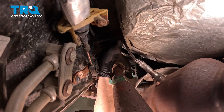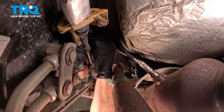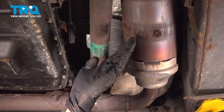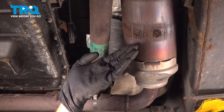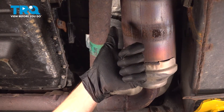We'll continue on with that wiring harness, bringing it up and over the mounting point, preventing it from falling down onto the hot exhaust or getting damaged in any way. We've finished the installation of our downstream O2 sensor. The process for one side is the exact same as the other. After completing your installation, make your way out from under the vehicle, start the vehicle, let it run for a while, make sure you have no check engine light or running condition, and take your vehicle for a road test. Thanks for watching.